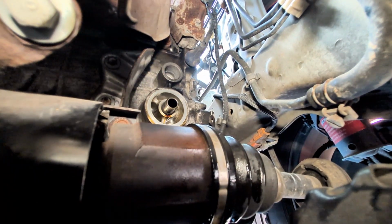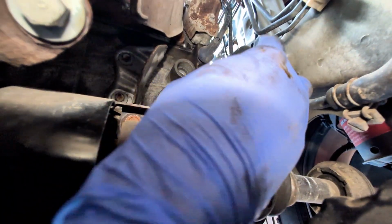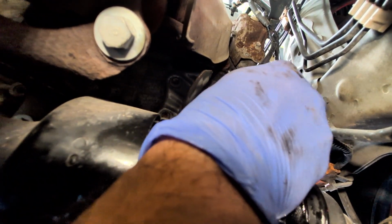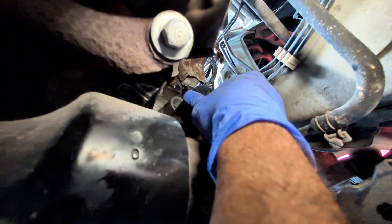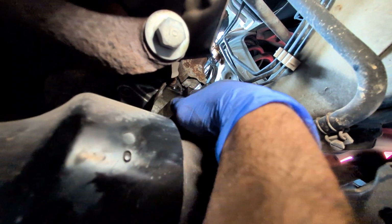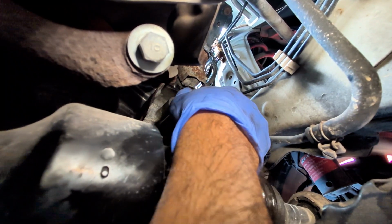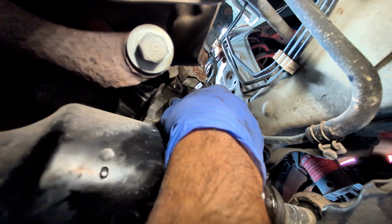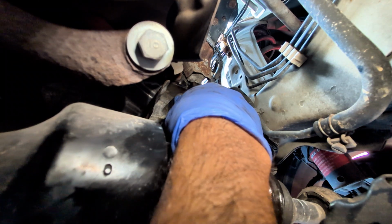All right. Now you see that right there? That screw looking thing with the circle, that's where your filter goes in. Now, from what I've always learned is that your filter doesn't really need tools to put it in. You should just be able to tighten up with your hand. Now, if you move it around, you should be able to get your thread. It should kind of thread in by itself. So take your time and get it to thread in. Don't force it. And once it threads in, it should go in easily. You see that? And I was always taught to tighten it. And once it gets tight, go ahead and give it another quick turn to make sure it's really tight. So that's what we're gonna do. And then once that's done, we're gonna go ahead and start putting the oil in.